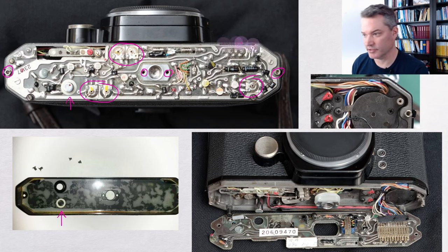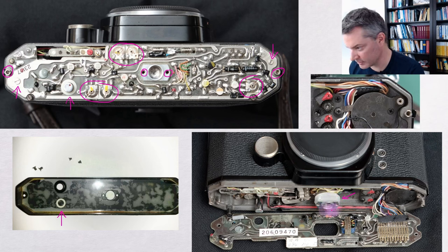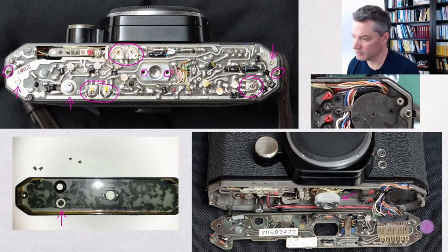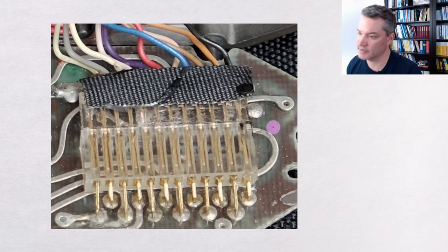Five of the trimmers needed for calibration become immediately accessible from this side. To further take out the circuit board you need to remove two screws — this one being larger than the other. When you remove the circuit board, also take care not to lose the isolating collar around the tripod mount. The circuit board is connected to the camera body by 11 cables attached to a 12-pin plug. This is how the 12-pin connector looks — probably somebody was already in there and had a tough time getting this connector apart.